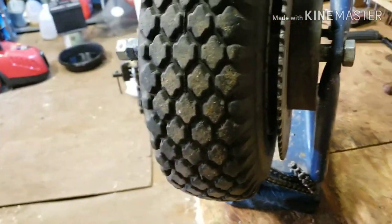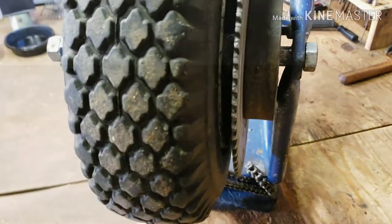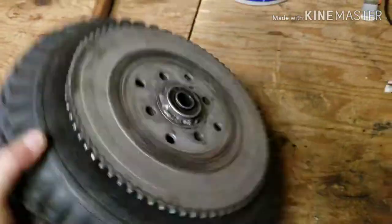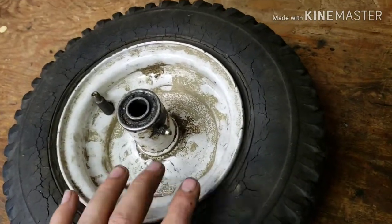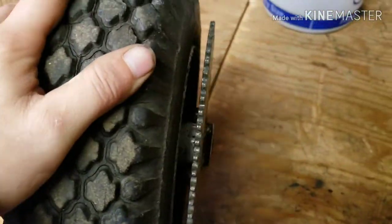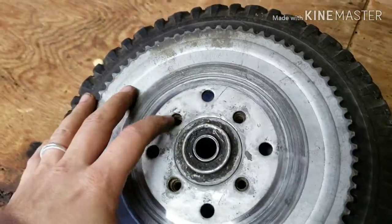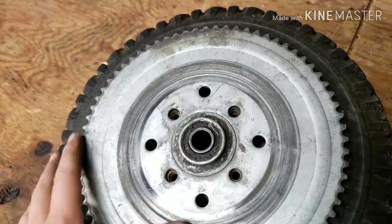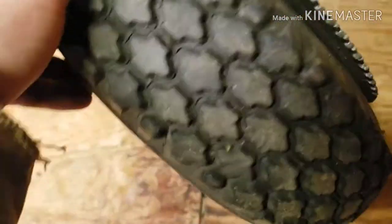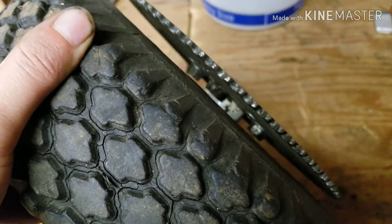You don't need to see this process. Alright, so I got it off. Brake drum — bolts on there, four bolts. My issue with this is, this isn't a standard minibike tire. This is from a wheelbarrow. You can see you've got your outside bearings here and there. Sprocket there. Normally these sprockets — you can see these bolt holes — there will be a plate behind here that the sprocket sets on. The hub centers itself on there and you bolt it down through the drum. Like that — it holds it all together. My issue is, since this was for a wheelbarrow, it didn't have the plate back there.